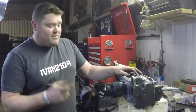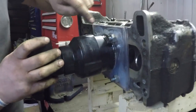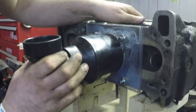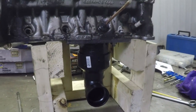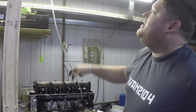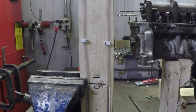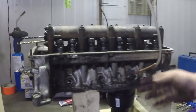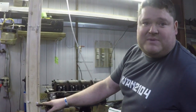Here's the final assembled product of our vacuum chamber. It's just a couple of pieces that are press-fit together. We have our holes drilled, our piece epoxied in, and then using some bolts we bolt it through to the cylinder head — that's where we apply our vacuum for testing. It plugs into the head so that when we apply vacuum with the valve open, it measures how much restriction is still left in the chamber that is not pulling through your intake valve. It just pulls up and tells us how much vacuum is on that port, so as we open it up with a bigger camshaft, better valves, and porting, we should see less and less vacuum, which means less restriction.